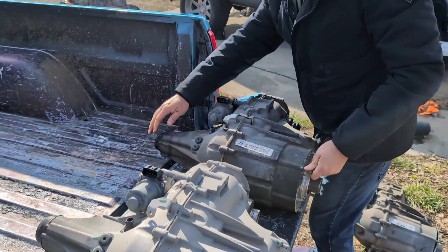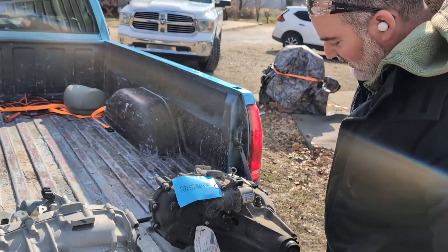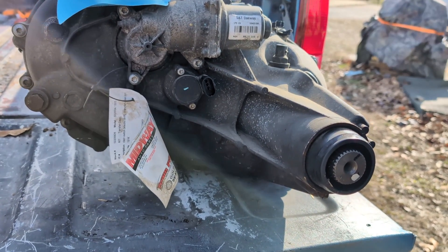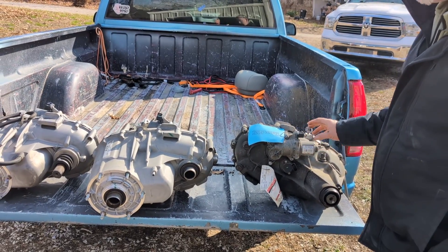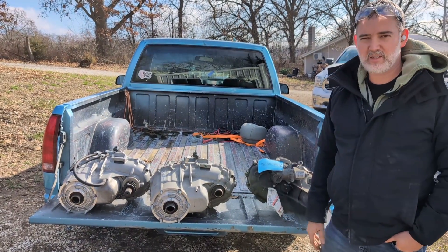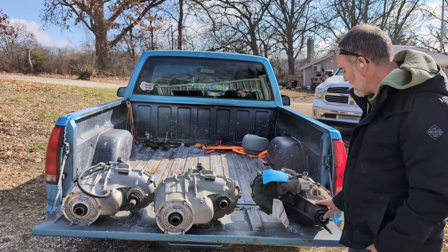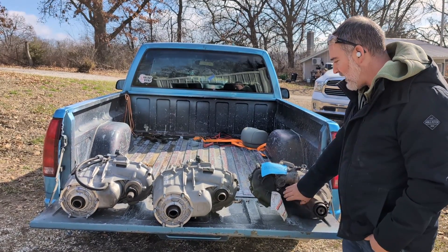I'm going to turn this one around to show you the difference between a 2023 T-case, which is what these are, versus the heavy-duty T-cases. You'll have this range position sensor right here. The HD T-cases don't need this because there are no clutches in them — they just lock in high or low almost instantaneously. These are all auto T-cases, meaning you can put your vehicle in auto mode and the clutches engage or disengage when you have tire slip. This is the standard T-case that comes in all V6s and V8s with 6-speed, 8-speed, and 10-speeds. Your 1500 series trucks — 2500 series and up will have a different T-case and will not have this range position sensor.